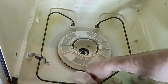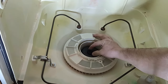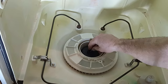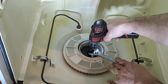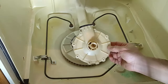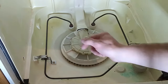With the new filter back in, make sure everything is scrubbed out. Now I'll put the impeller back on — this black piece only fits one way because the piece underneath is grooved, so make sure it pushes down. Get my screw with the little washer back in there, holding it in place with the adjustable wrench. I'm also replacing my water feed tube going up top — that just clips back in. Then I put my cover on, making sure it seats into the water feed tube, line up the holes, and screw them all back down.